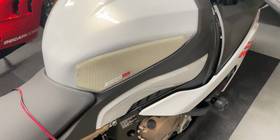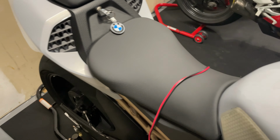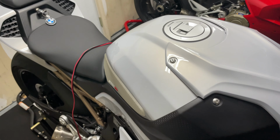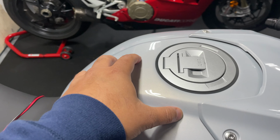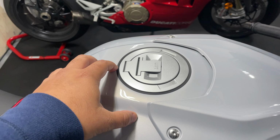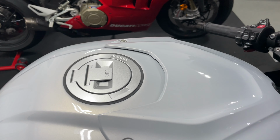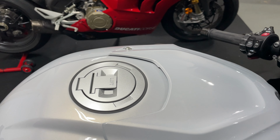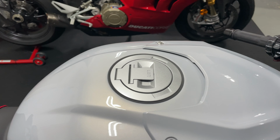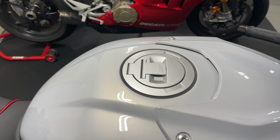So today, some of you have messaged me about how to maintain the battery or winterize the bikes. I usually put fuel stabilizer in the tank, with enough fuel in there so it doesn't rust or corrode. When the weather is nice and there's no snow on my driveway, I can just start it up and maybe ride around a couple of blocks and then come back in.